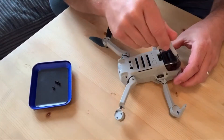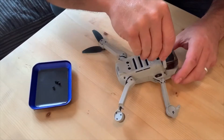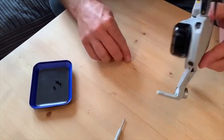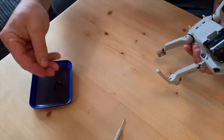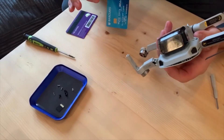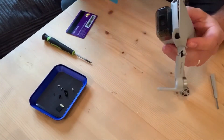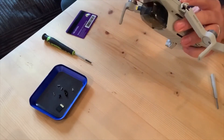I'm going to undo these four screws here - this loosens off the top cover. The screws are so small, try not to lose them. I've found the easiest thing to try and pop that off is a card. I tried with a little screwdriver but I'm worried about damaging or scratching it, so I'm just going round the edges and prying it off with that. Just like that.